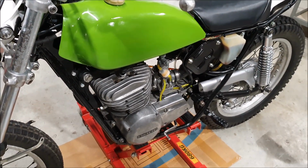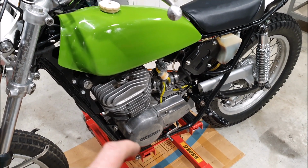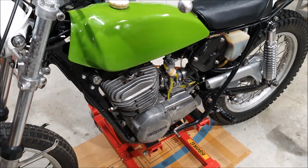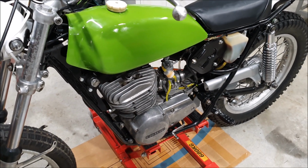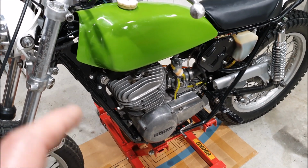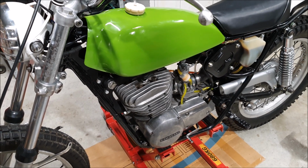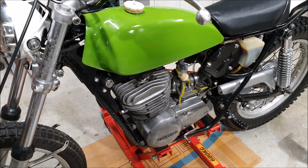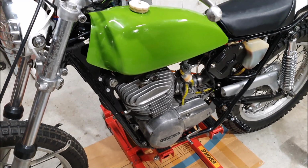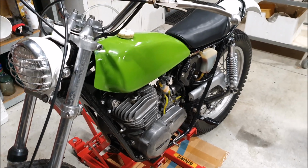I did look up some pictures of what the inside of the dynamo looks like. There are separate coils. There's 3 separate coils inside there. So one day when I take that apart, pull the flywheel off and have a look in there, I suspect the coil that drives the lights, the lamps, is burned out. And it looks like it's easy enough to rewind those. You just sort of measure the wire and you figure out how many turns there are, and you can actually rewind them yourself. But the bike's looking good.